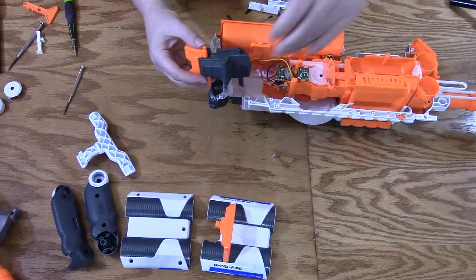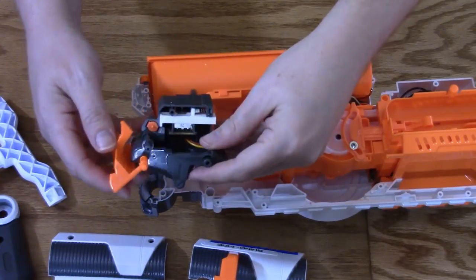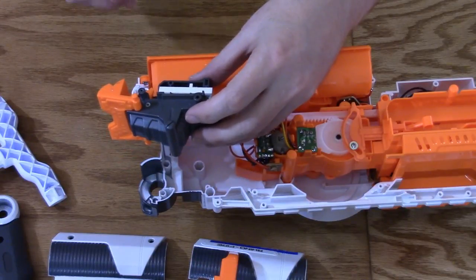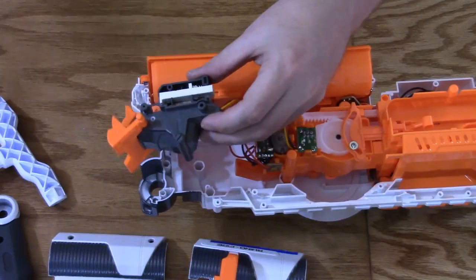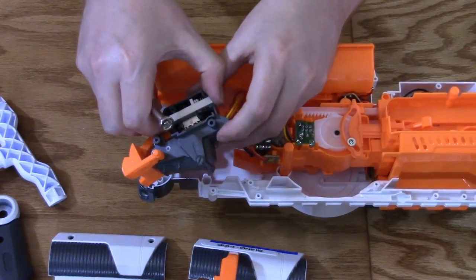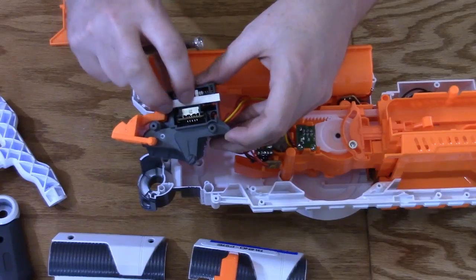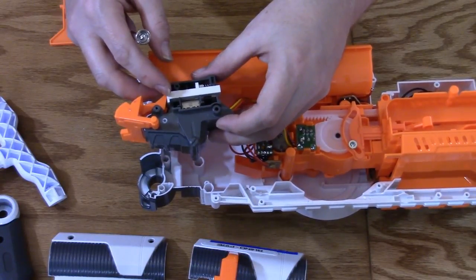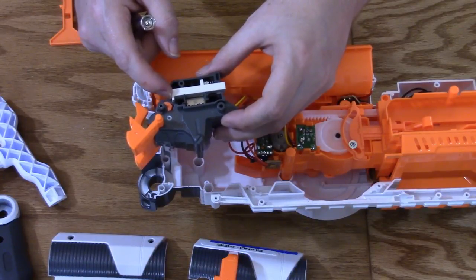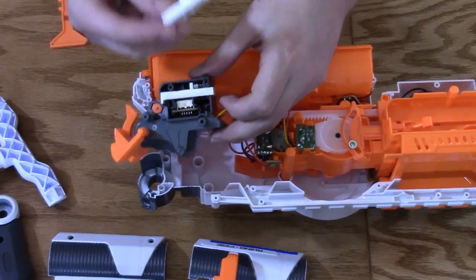And this is your trigger. There's a little circuit board with the switch, and then the piece that I replaced. There are two clips on the inside. If you take a screwdriver and pry the clip that's in the middle out, the original piece will pop right out. After you add the replacement piece, it's a really snug fit, so if you ever need to remove it again you'll have to pry quite a bit harder. It's reinforced in as many places as I could come up with. You pop out the orange piece and slip in the replacement.